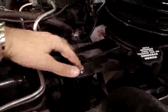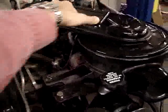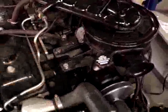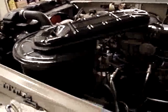Here's the extra bracket we made, here's the bolting of that bracket, and we are allowed to keep the stock carburetor with the stock air cleaner, which all goes on. It may be hard to tell from the video, but if you know what you're looking at here — the air cleaner and these brackets that go onto the head — looks real good. It'd be hard pressed to tell that we really did anything other than just shift this over and put that pump in there.